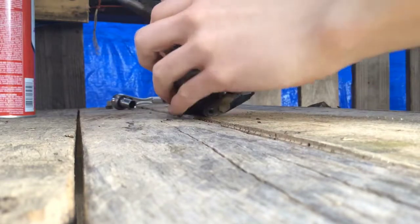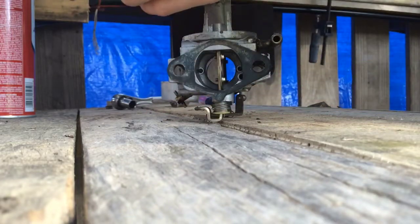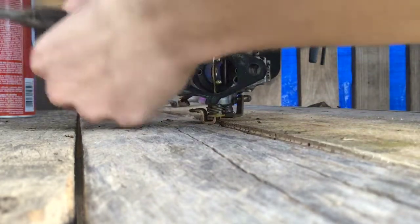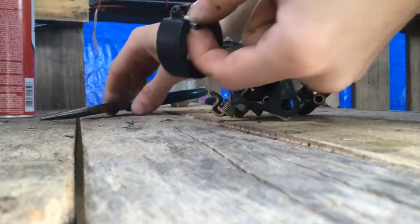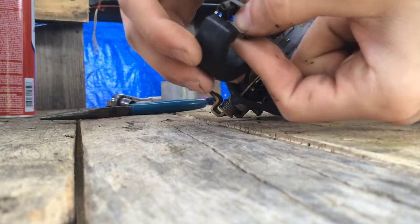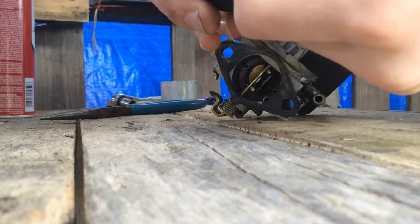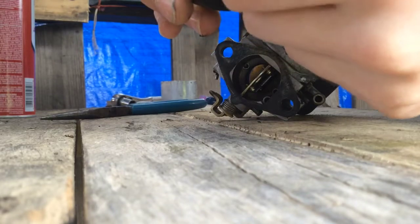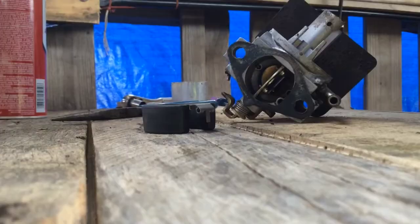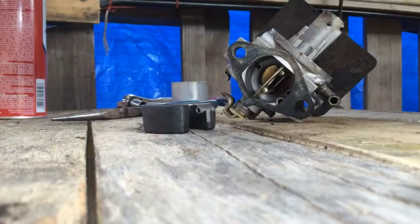You're going to have a crappy day, because if your day wasn't crappy enough having gas in your oil... and then here's your float. Okay, here's your float and needle — this will slide right out. Come to think of it, I haven't taken this one apart yet, but they're all the same. Don't lose that float either.